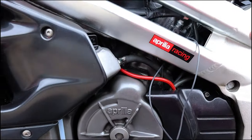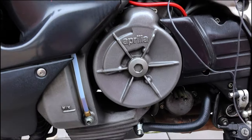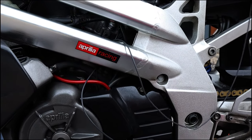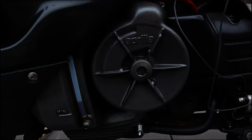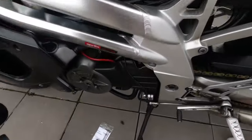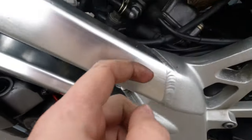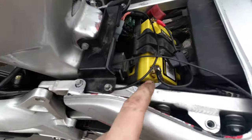Next I'm just routing the cable. I'm not sure this will be my final routing, but for now I'm going to go back up through here, in along the frame rails, and into where I'm mounting the actual unit up here under the seat — I'll show you in a sec. I'll torque this to seven newton meters in a minute. I have that run up there in behind the frame, in along here where I'll cable tie it in a minute, then in and under here.